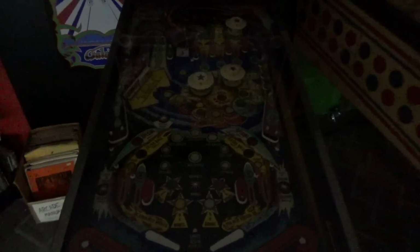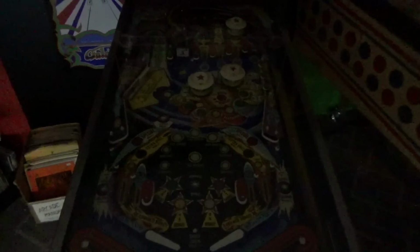I mean, it wouldn't stick down. It would just go down and up like it's supposed to. But whenever you're playing it, it keeps kind of sticking down. Well, now we know it's not the coil, so the coil's not going to burn up or anything, because even with the power off, it's still stuck down. So it could still be something is sticking, or it very well could be that it's magnetized.